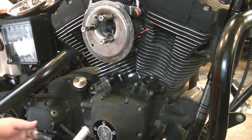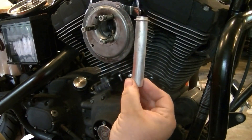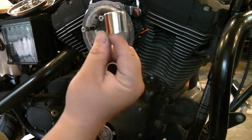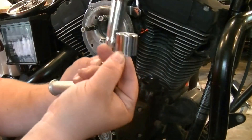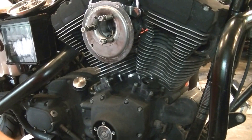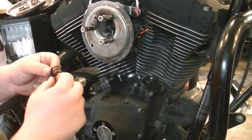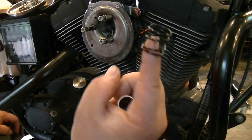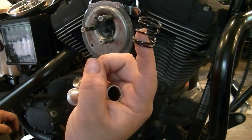We're back after cleaning up our old push rod tubes and top ends we had to use. Aluminum top end — it didn't come out too bad looking, but it's just aluminum and you won't see this part at all. Really impressed with Mean Green and a little brass brush on the collar. We also took the old rusted springs, dipped them in some Mean Green, hit them with a brush to knock off all the loose rust, then coated them with some epoxy paint and baked them in the oven for about 20 minutes at 150 degrees — not a real high-temp paint, but just enough to fast-cure it so we can put this back together.